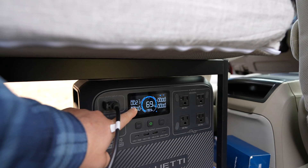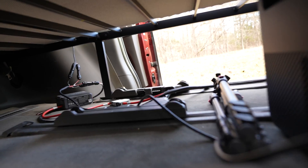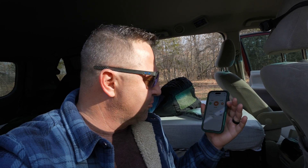Right now I'm pulling in about 20 watts from just the solar panel with the Charger 1 turned off. To get the solar panel to operate better with the Charger 1, I set the output voltage on the Charger 1 to 27 volts, essentially matching the solar panel's output. Because the Charger 1's amperage is higher than the solar panel's, when the vehicle is running I'm only getting power from the Charger 1. When I turn the vehicle off, I get that trickle charge from the solar panel. The sun is not very high right now, so I'm not getting a combined capability from both systems simultaneously.